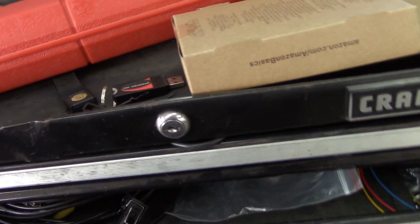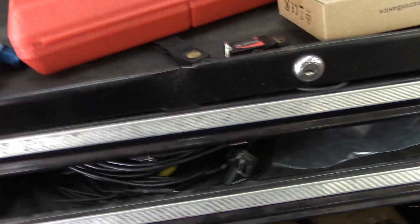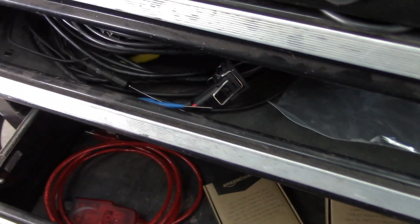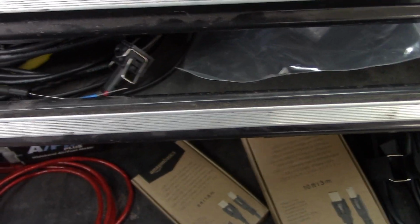Oh, down here maybe. Yep, right here. So, wireless headphones, and I can hear the engine noise, but it also makes a beep when it's hearing knock. So what you do is you have to do a pull at a conservative ignition timing, conservative fuel. That way it's recording the actual engine noise, and then from there you can figure out what's considered knock or pinging or whatnot. And from that point, you can increase the timing, and it's going to tell you basically what is not good noises.